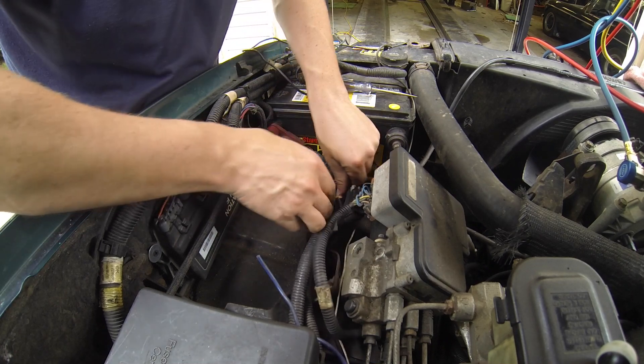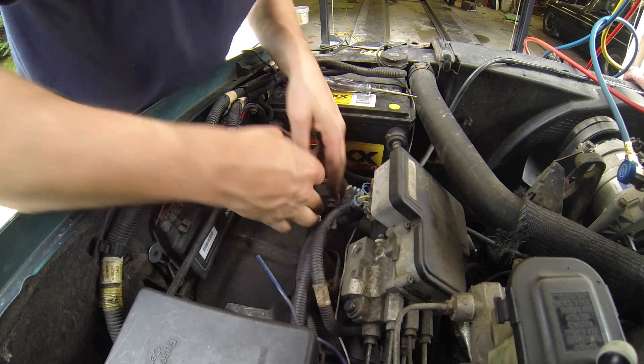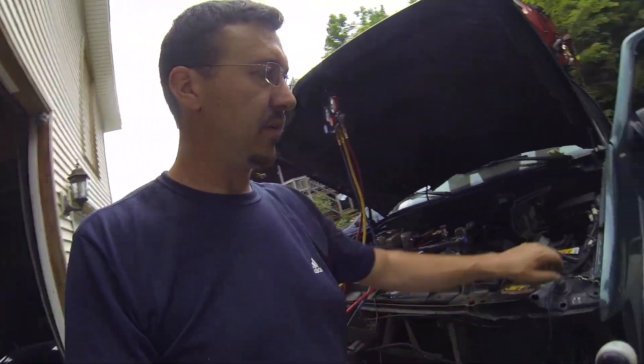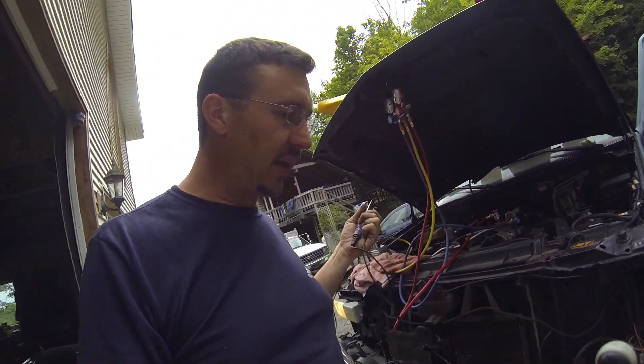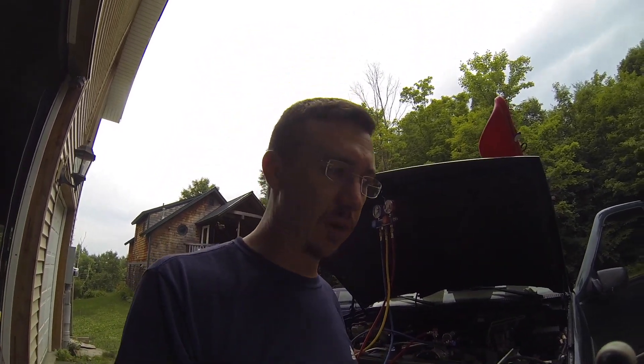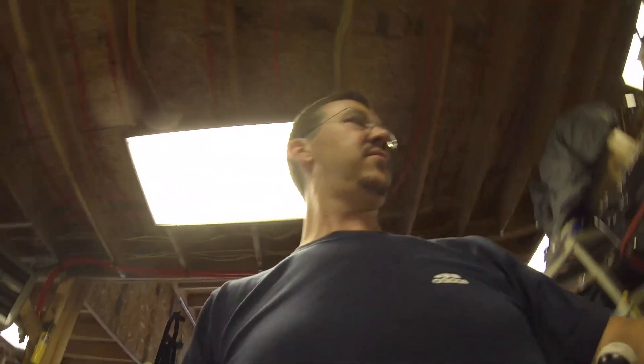The only other thing I would check is the headlight fuse from the car, but because I already have my test light out and I know I'm getting power to the headlight harness, that's covered. Unfortunately it looks like the isolation module must be bad. I can say with about 95% certainty there's nothing wrong with the headlight, nothing wrong with the wiring, nothing wrong with the harness — it's the isolation module. Electrical troubleshooting: don't be afraid, it'll be okay. Thanks for watching.